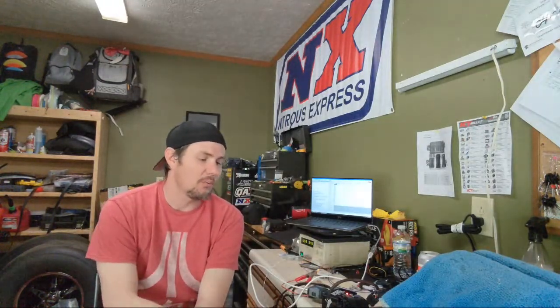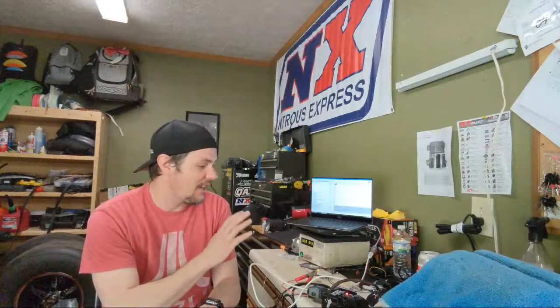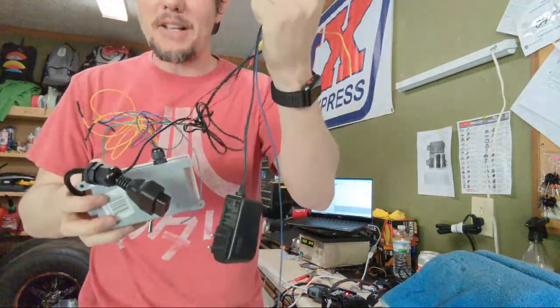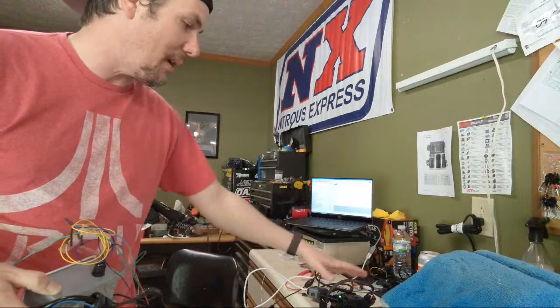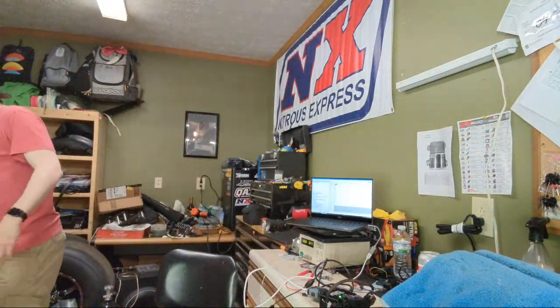The question was whether it just passed on OBD2 information or if there was some way of accessing these ECMs on the bench. We had a pretty good idea it was available, we just didn't necessarily know how. BenchForce had already developed this harness, and that's the only reason I bought it. It's nice to have because if I need a harness for a different vehicle like an E38, they're about $90 and you've got a nice plug-and-play assembly for bench programming on any ECM or TCM. Their website is benchforce.com - go check them out. Compared to my old bench programmer, which was a little sketchy, this has clipped-in connections - everything is solid and you're not going to worry about a wire pulling loose during a write.